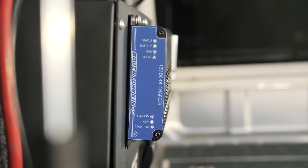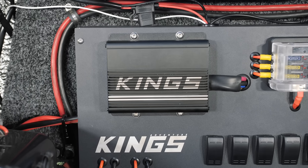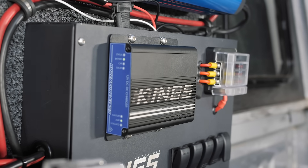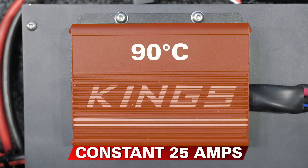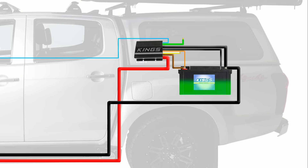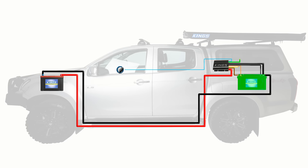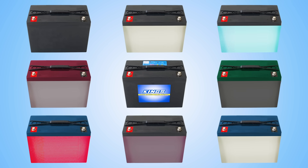The next awesome function of some DC-DC chargers is the solar input, but I'll go into more detail on that in part three. When you're shopping for a DC-DC charger, do your research. You want to look for a model that's able to put out the stated amps even when it's working hard or heating up. For example, this 25 amp model is able to put out 25 amps even when internal temperatures are approaching 100 degrees Celsius. It also features a battery temperature sensor, so it's been designed so that the battery is the limiting factor. Because batteries shouldn't be charged over 50 degrees Celsius, this DC-DC charger will taper off the charging if your battery starts warming up too much. That's an advantage over a more traditional dual battery setup — not to mention they're almost a necessity if you're running batteries that require different charging voltages, which in many setups is the case.